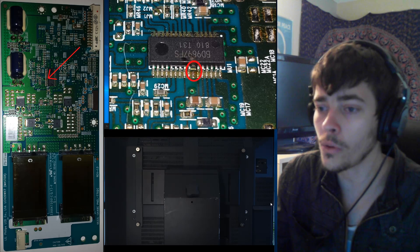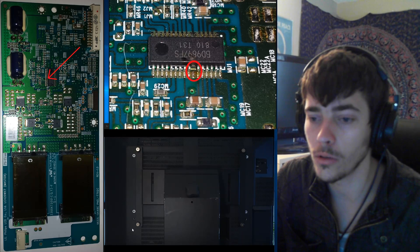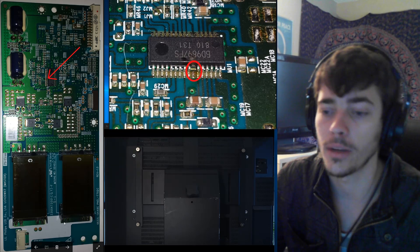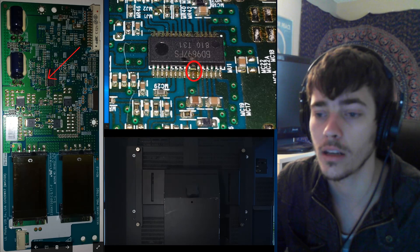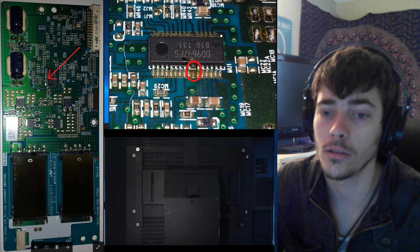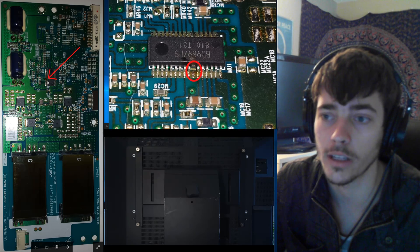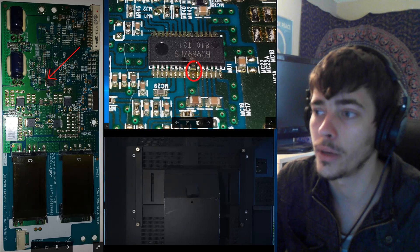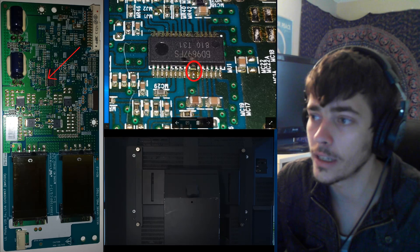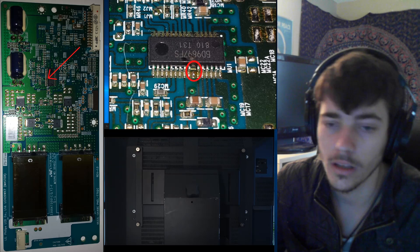There are two boards that control the back panel: a master board and a slave board. One of them will go out — both could, but that's highly unlikely. If it's behind a metal shield like mine was, you'll see these two black blocks. I would check the master one first — it says 'master' right here. You take off the shield with about four screws, and this central chip in my case was defective — it's burned out. You can see how that connection has been severed because of that burnout. When that pin gets burned out, the chip cannot communicate to the board or tell your backlight to turn on.